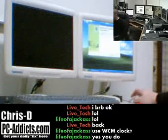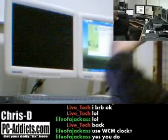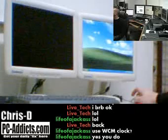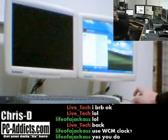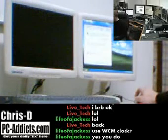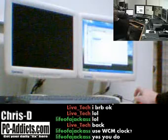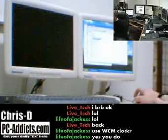So we're going to skip over that. Normally when you get a video card, you get a disc — just pop it in there after you install everything and install the drivers, and then you'll come up to some sort of a wizard. I'm going to bypass the wizard — I'd rather just configure it myself. So what I'm going to do is first go into Device Manager just to make sure we don't have any problems. I want to make sure it sees the card — yes, NVIDIA GeForce. I have no yellow exclamation marks or question marks, so it's good to go.